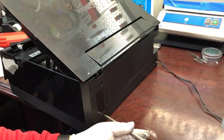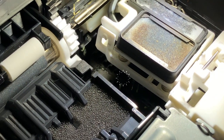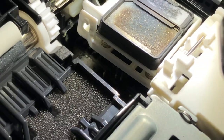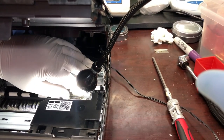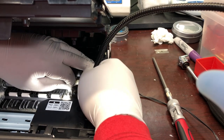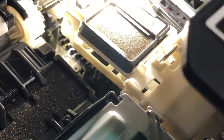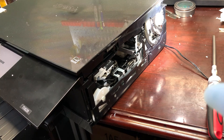Most of the time you're going to have this second case, which is the easier one: the forklift is still in there and not totally out. It's rare that you jerk the forklift completely off the lever. So basically you just lift it up a little bit and push it forward and it will fall right inside into the slot. For this case, while feeling around to see if the forklift was still attached, I accidentally just pushed it right into position and got it fixed. It just falls right in there — it goes up and down and the problem is fixed.